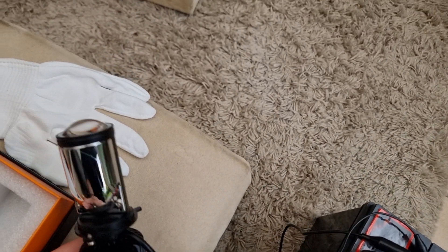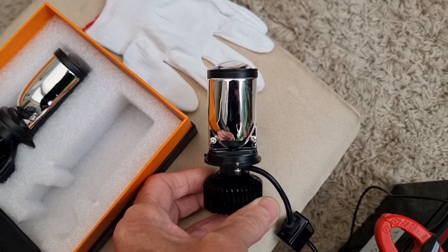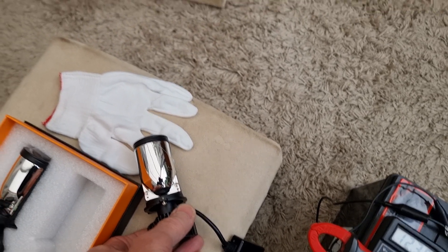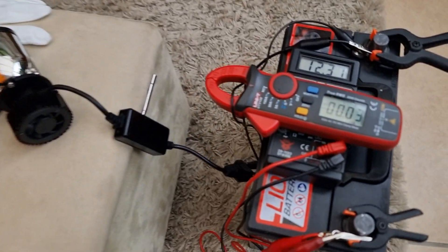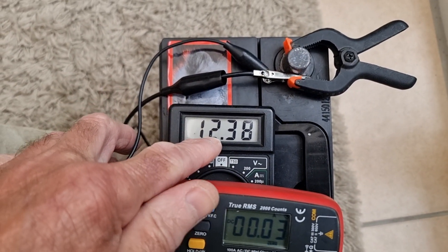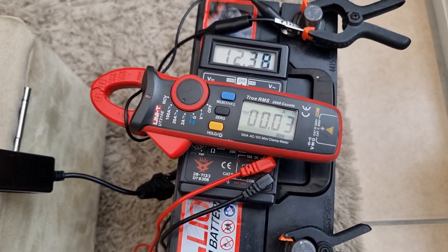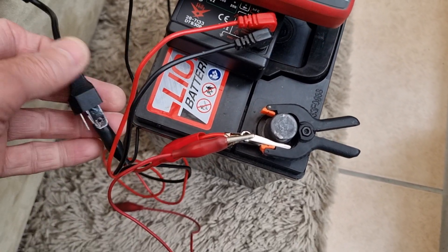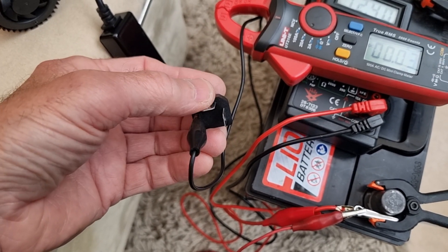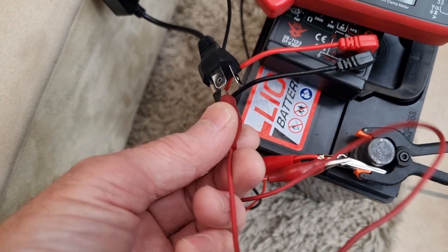So we'll test these outside of the car lens. I will do a follow-up video later just to show what they're like at night, but I thought we'd do it now to see what they look like. I'm in my conservatory in full daylight. I've got a car battery currently charged to 12.4 volts and a clamp meter to see how much current these things draw. Ground is on the left, then dip beam, then full beam. Let's plug it in and see what happens.